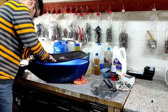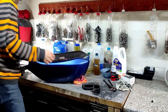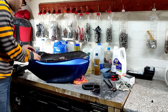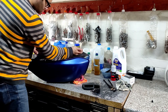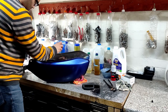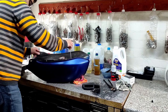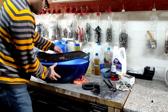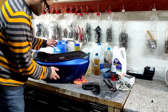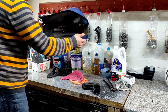Luckily with this tank I don't have to clean inside it. I'm using a screwdriver and you can hear everything is nice and sound — there are no rusty spots. What tends to happen is if you want to do a full-on clean on the inside of the tank, that's when it gets interesting. You can get acid, you can get tank cleaners; if you want to do a DIY job you can get vinegar, leave it in there overnight, fill it up to the top and then drain it out.